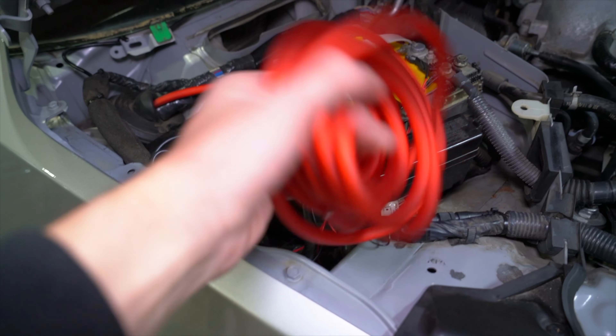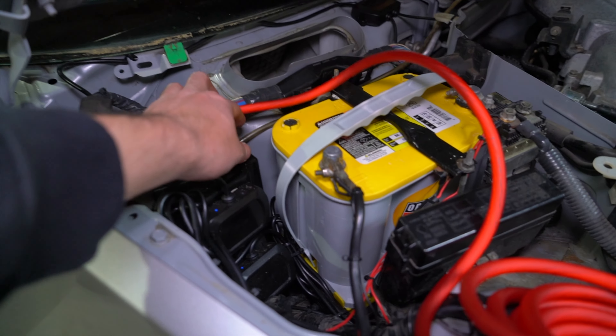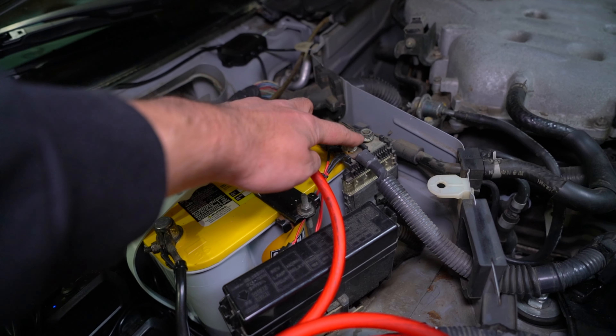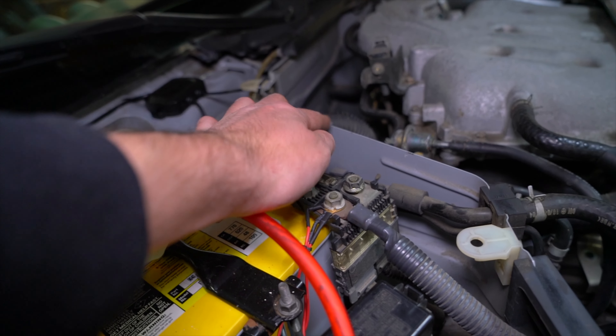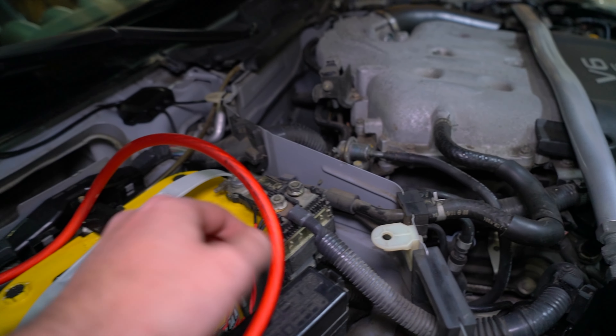We are officially moments away from testing out the stereo. The last thing I need to do now that the subwoofer wire is run is get the whole system hooked up to the battery. I've got the four-gauge wire running from the amplifier that needs to connect to the positive side of the battery. I'm going to run it back up around here and connect to this terminal. We do need to put our fuse in-line here — they recommend doing that within six inches of the battery — so I'm just going to mount it to the inside of this wall here and we'll have our wire go in through there and come out the other side.